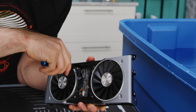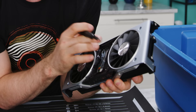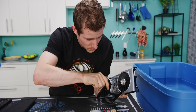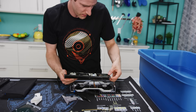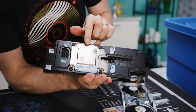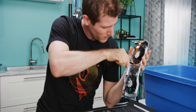For our next trick, we'll be removing these four screws, which will allow us to remove this PCB — that's something we don't want to hydro dip, because it will ruin it. The next thing we're going to do is remove these four screws followed by this one, which will allow us to pop off this shroud, and then pull this ribbon cable out of the part of the cooler that actually makes contact with the GPU itself. So there you have it — that's the actual cooling core of the RTX 2080 Ti. There's your vapor chamber, there's your fins. We don't want to paint that because that would actually hurt our thermal performance. One thing we definitely need to do is pull these fans off. The last thing you want is paint in your cooling fans.